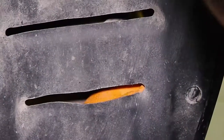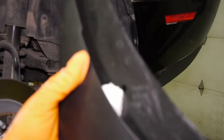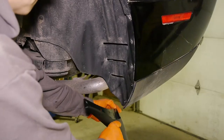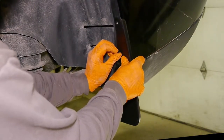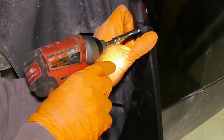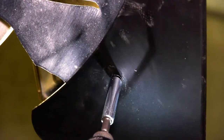It's a bit tough to push the u-clips on all the way but they'll go on eventually. Now install the mud flap marked as rear left hand — make sure you hook it in just like the front, and attach two of the supplied screws. Use your mud guard as a guide to drill a quarter inch hole in the lower hole, making sure you go all the way through. Then take the last u-clip, push it on the bumper where you made the new hole, install the last supplied screw, and you're done.